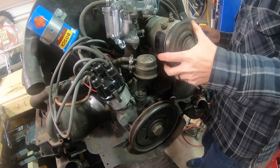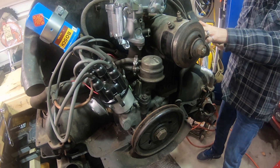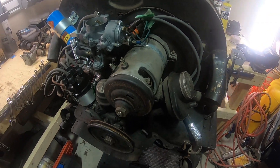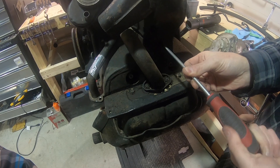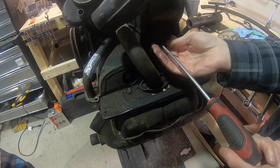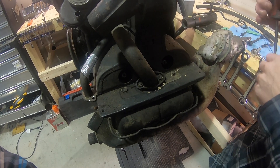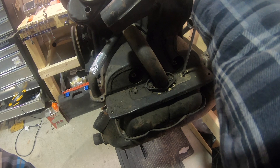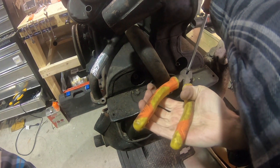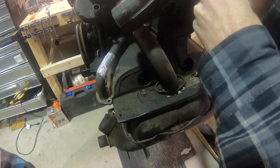My generator is now free. I'm going to remove the tin screws. Something I always do is I don't like slot screws — these will not be going back in when we replace them. We will be putting a 10mm bolt head on those so that we don't have issues. Sometimes these are very tight, but if I put my screwdriver on and use pliers the way I did there, it helps break them free — you have more torque and it gets it going.